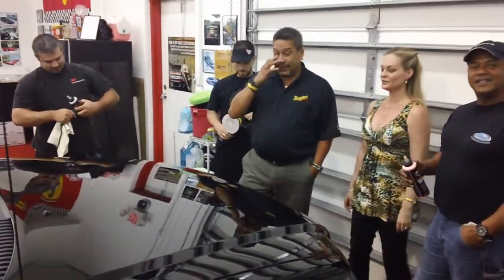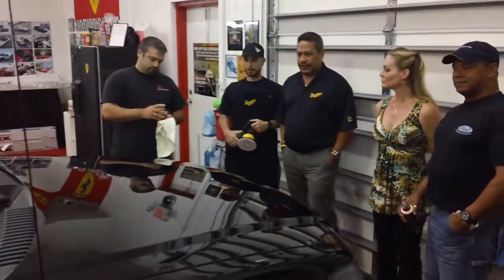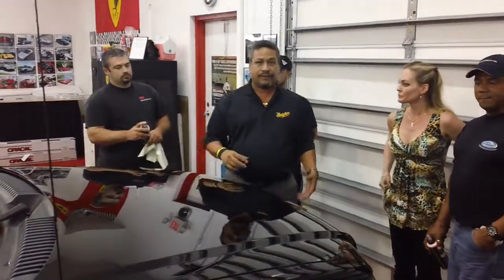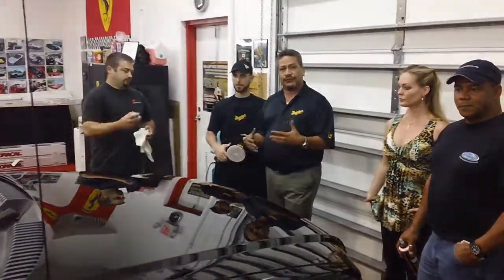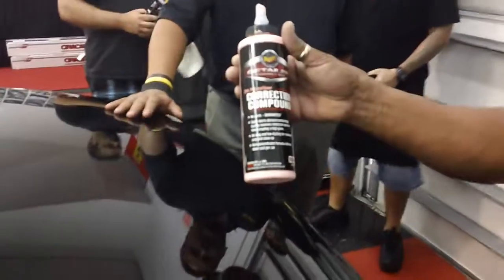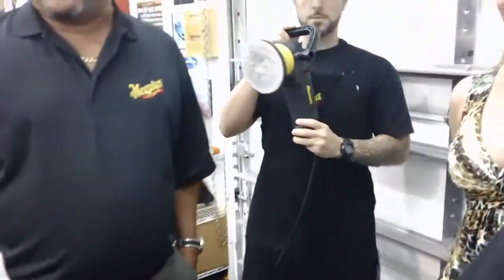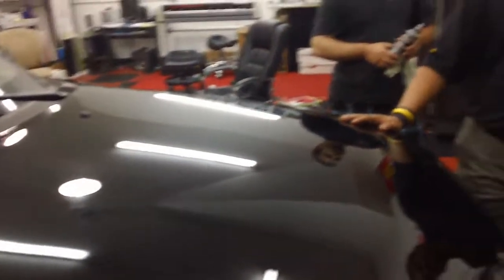We just explained to Wendy and Pepe what we did on the car. We basically took a light detail — did some wash to get it prepped and ready for paint protection film. To start that, we used one of the new Meguiar's DA microfiber compound system products. We did a two-step job with a DA polisher and we were able to bring up the shine, deepen the gloss, and basically prep the car so that the next steps in the paint protection process come into play.